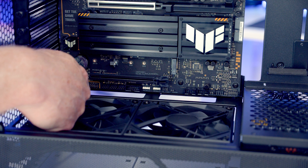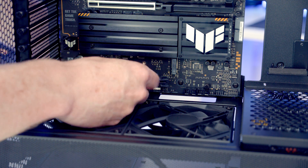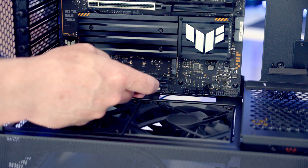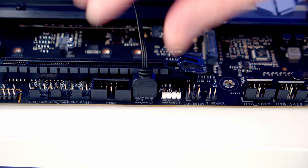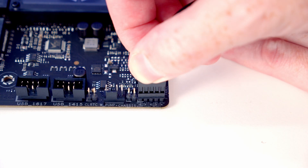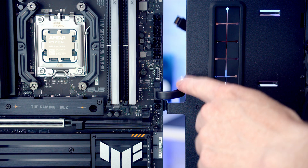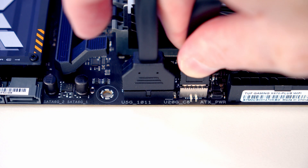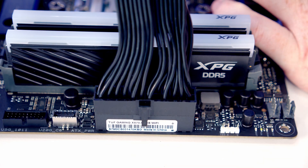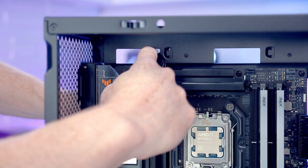The HD audio cable goes into the header on the bottom left of the motherboard — bring it through the cutout and plug it in with the HD audio text facing up. Next, bring the bottom fan cable through and plug it into a system fan header. Then bring the PWM cable from the front fans through and plug into a header, and the RGB cable from the front fans into one of the two RGB headers at the bottom of the motherboard. The front panel connectors go into the header at the bottom right — bring through the cutout with the text facing up. The USB 3.2 Gen 1 header cable goes through the cutout and pushes into place, and just above that the front panel USB Type-C header cable is connected. Finally, the 24-pin cable is brought through and connected, and the 8-pin EPS cables are routed to the top left of the motherboard and plugged in, with excess cable pulled through to the back.